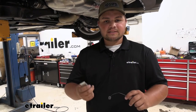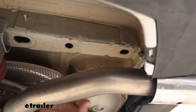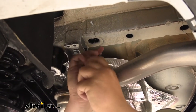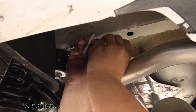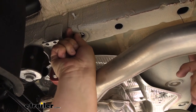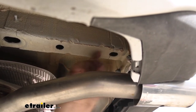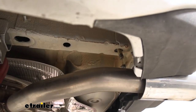After we have enlarged our hole, take our pull wire, our spacer block, and our carriage bolt and insert it into our frame. We're going to be using this hole and this hole. I prefer to fish wire from back to front, so we'll put our coil in through this side, pull it out here, slide our hardware on, and pull our fish wire through. Make sure to leave our extra pull wire on the other side just so that our hardware doesn't slide into our frame. Thread on our carriage bolt and insert our spacer block, then our carriage bolt — you might have to put your carriage bolt in backwards. Push it up into the frame, then pull our pull wire through. Repeat that process on the other side and for the remaining hole as well. The kit only comes with two fish wires, so after you get your first bolt in, unthread it carefully and repeat the process for the next hole.